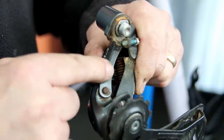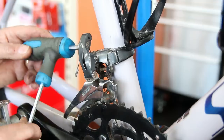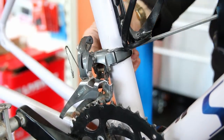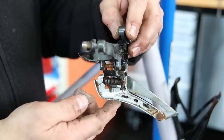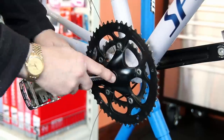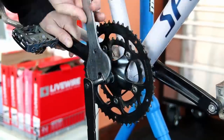You can see there's quite a bit of rust on these components - they've got very wet, the spring in there is completely rusty. That's one of the reasons why we grease those springs, to aid against corrosion after a bike's been serviced. Off comes the front derailleur - you can see how rusty the pivot points are. Although we did put this through the ultrasonic cleaner, it wouldn't free up, it was solid as a rock, so we actually ended up having to replace the front derailleur. That part was life-extinct.